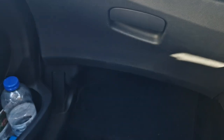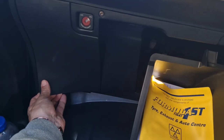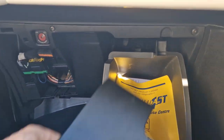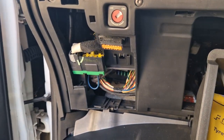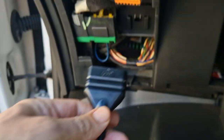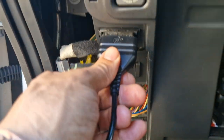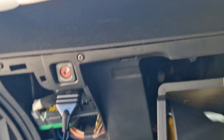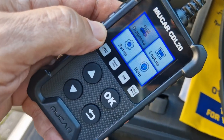So we're on the Citroen DS3, and to get to the OBD port you just open the glove compartment and pull from the left here — and that comes off. Hopefully get some light on that. Get your tester; you can see which way around it goes. The wider end is at the top on this one. As soon as you plug it in, there's no need for batteries — it will start to power on.